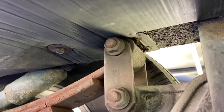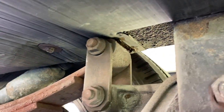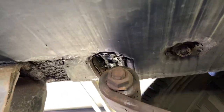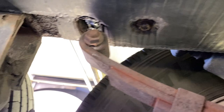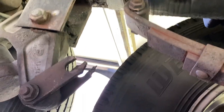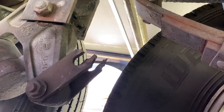The connection you see there is called a shackle. It's literally just a thin piece of metal that attaches a leaf spring into the center. And on this side, as you can see, it broke right out. Fortunately, the leaf spring just sat up against the frame and it wasn't off angle at all, so the tire didn't get any extra wear and we were able to get down to this campground. But now I got to try and find these at a tractor supply or a local RV store and replace them.